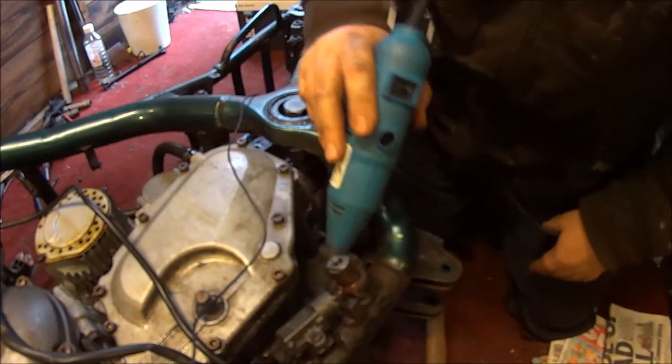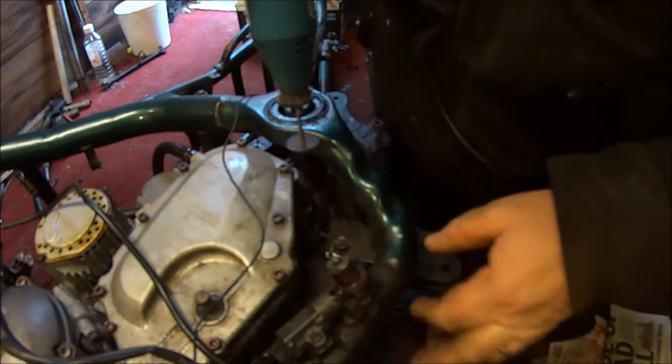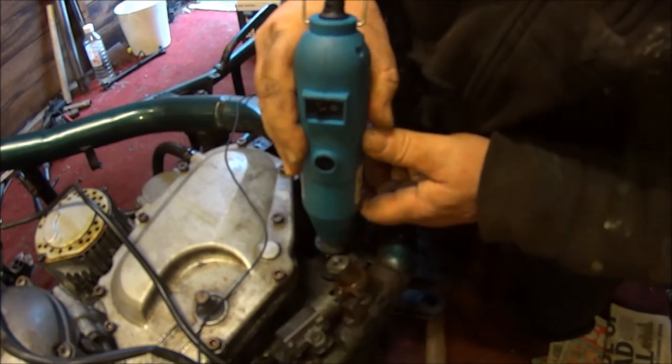Update: I haven't actually got to the bolt yet, but I think I'm getting this flange washer out of the way. If I can break that off, then I might be able to get to the bolt. Update: I'm nearly through the bolt, so I'm lying the bike down. I've put some engine bolts back in but they're only loosely put in - I don't want the bike upside down and the engine falling out and smashing open. I'll lay the bike down now and try to cut the rest of the way through this bolt.